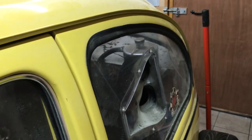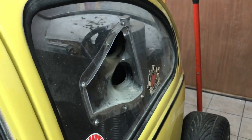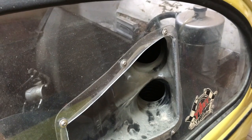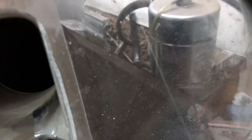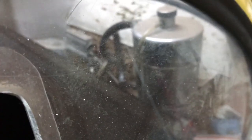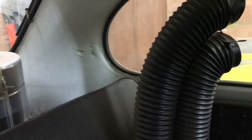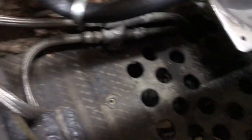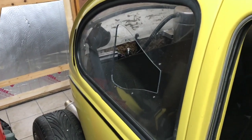So it's probably best if I start at this point of the car. In each rear quarter window I had some cooling ducts, an oil cooler, and also the charge cooler radiator located behind the rear seat. You can still see the reservoir I had in the back for the charge cooler. Inside the car you can see the tubes that ducted the air to the radiators, which were located down on the baggage area floor behind the rear seat. You can see where I drilled some holes to allow the air to go through.